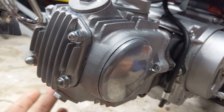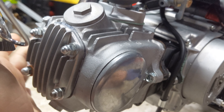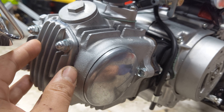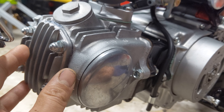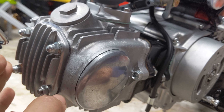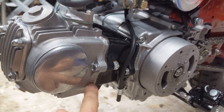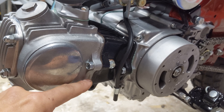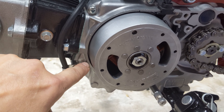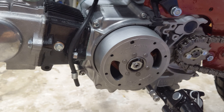Basically the pump pushes oil up through the lower stud, then it hits your right cam cover — the fin cam cover on this side of the engine — and that diverts it into your cylinder head, sending pressurized oil into the camshaft, the cam journals, lubricating the rocker arms and all the moving rotating components. Once it gets into the head, there's a galley at the bottom that gravity feeds that oil so it can drain back to the crankcase. It travels from the cylinder head through the cylinder and hits the crankcase area where all the oil sits, and it continuously refeeds. So that's the oiling system.